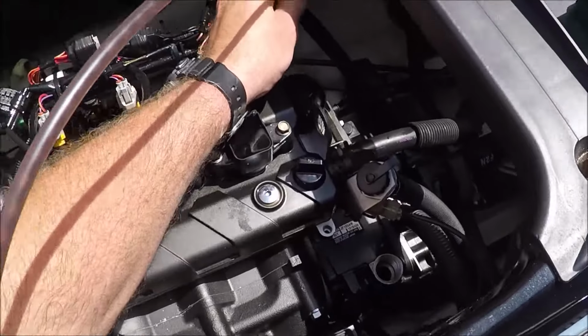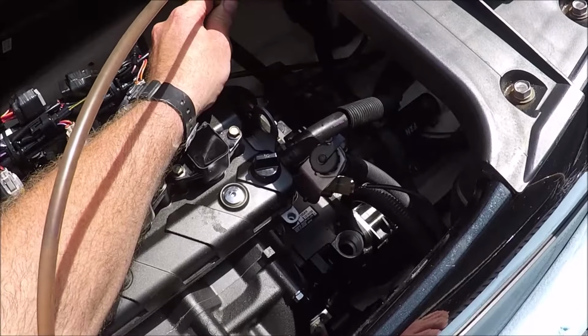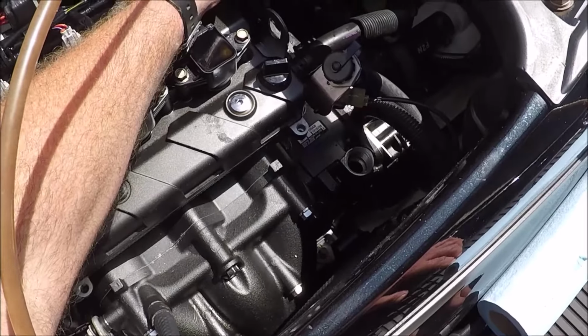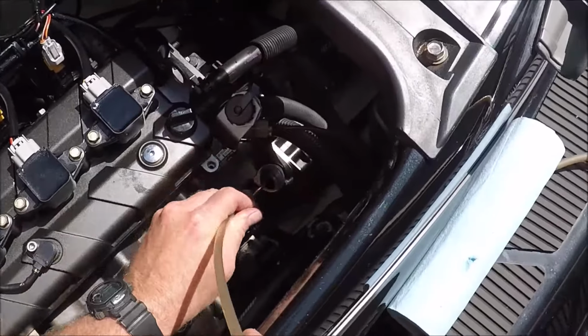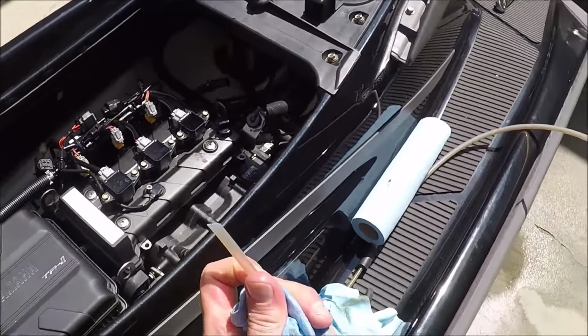So I think overall, when I look at it later on, it's a little over 3 quarts, maybe like 3.3 quarts or somewhere in there, out of the 3.59 that it should be, or the total that you could get out of it. Keeping in mind that a couple of ounces are in the oil filter as well. So I went back in the dipstick tube just one more time, and that will pretty much do it for getting the oil out of the machine.